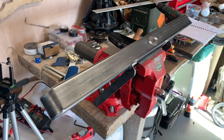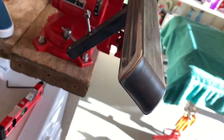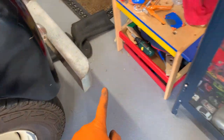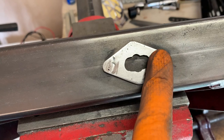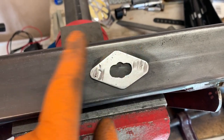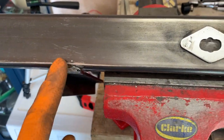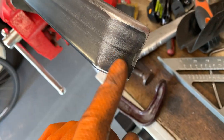One fully completed Toylander 1 bumper that just needs painted. I really dressed these over with the angle grinder, then went over the corners with the file and then sanded them as well. There are a few little marks but if you look at the bumper on my own Land Rover there are visible welds too. The escutcheon plate is welded on, welds ground down, filed and sanded. I didn't know whether to leave those as spot weld-looking things but I've just done them anyway. Going to go over this with some cleaner - white spirit is my usual flavour because it's nice and cheap - then get some acid etch primer. Despite it being a wet day to start with, it turned into quite a nice one, so might as well crack on.